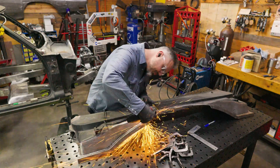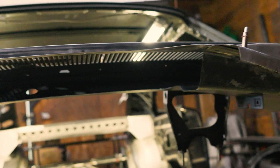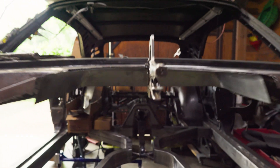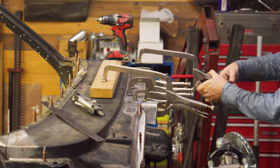Whenever I make custom stuff like this, I fit the panel dozens of times, over and over and over. At every point something has changed, it all gets fit and reassembled. I generally try to avoid making more than one adjustment at a time — it keeps it all kind of straight in my mind. This cowl structure is like a reverse hood scoop of sorts, so that I can actually get a hand in here and remove the intake. As the engine sits back in there, there was just a little bit of contact area between everything. I don't know exactly how this is going to go, but I know what my next step is — pull it off, fit, mark, trim, just keep on going until these things sort of fit together. It's a slow process, but I actually really enjoy this stuff.